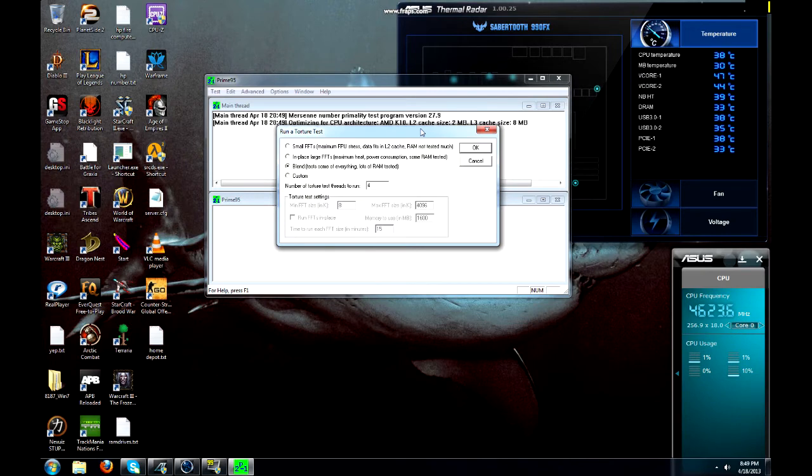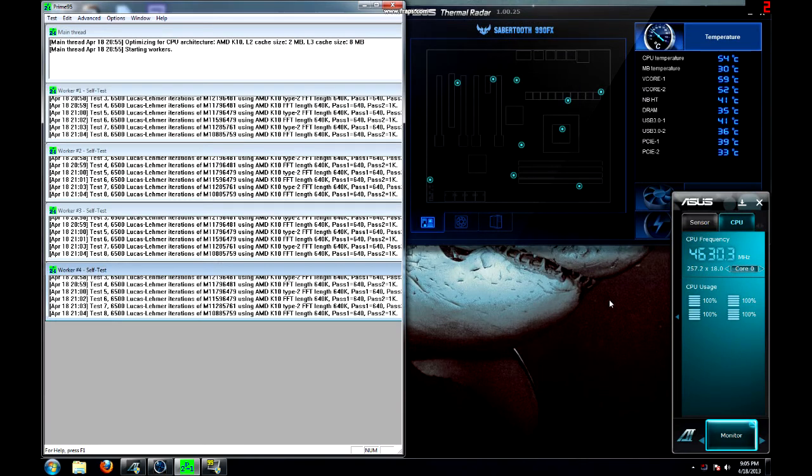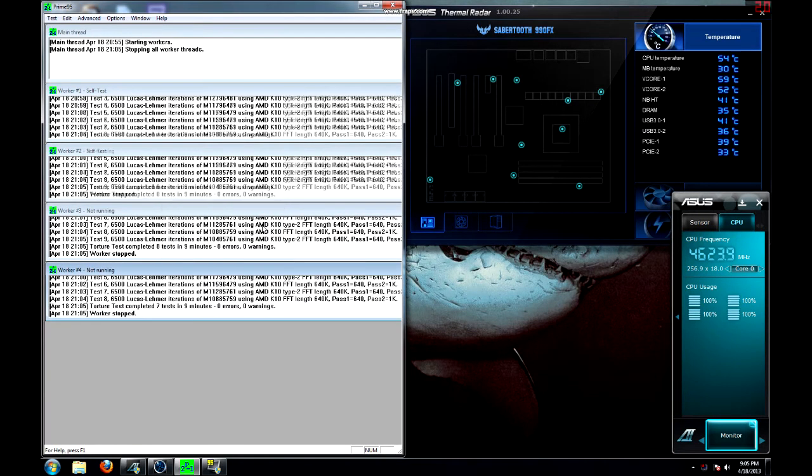Just for kicks, let's do a full 1GHz overclock. We did a frontside bus or HTT overclock and now it's sitting at 4.6GHz on stock core voltage, slightly altered. After a 10-minute Prime95 at a 1GHz overclock, it's sitting at 54 degrees Celsius and seems to have topped out there. After stopping the test, it's already cooling down rapidly — dropping from 54 to 50-51 degrees very quickly.